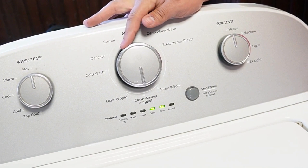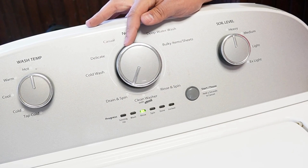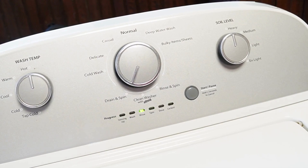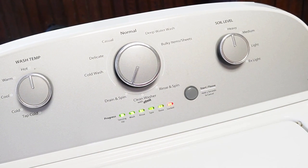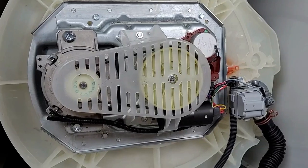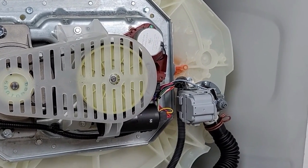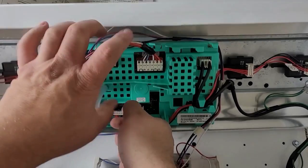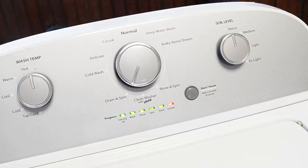Once you're in this mode, turn the knob clockwise four times. The rinse light should be the only one illuminated solidly — this is the recalibration mode. Once you press the start button, the door lid will lock and it will begin a series of tests and operations on your washing machine. All these tests take approximately three minutes to run all the way through. As the recalibration mode runs, every part and process on this washing machine is going to be run and the machine will physically reset all the components to a default state, allowing them to run at an optimal level. This is a must-have when parts aren't working right or the machine just doesn't know what state it's in, like when you've replaced the shift actuator or even a control board. During this time, you're going to hear all kinds of noises from the machine, and that's totally normal. When the calibration mode ends, every single light is going to turn off, including the lid lock light, and the machine is now ready and recalibrated for use at an optimal level.